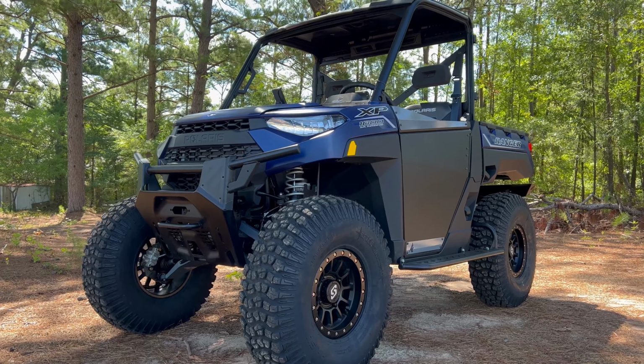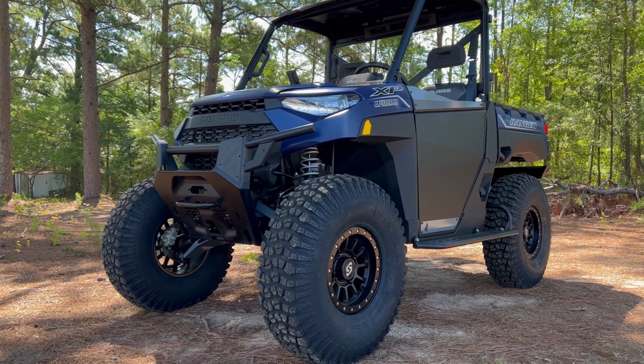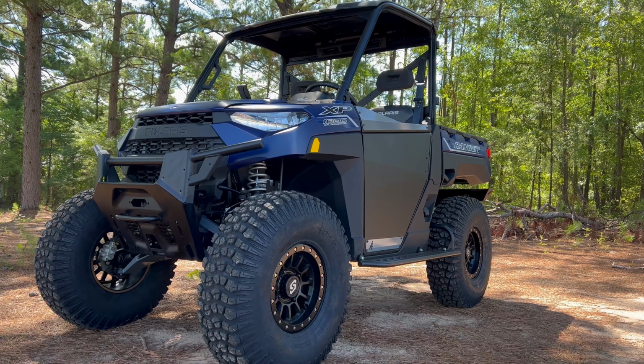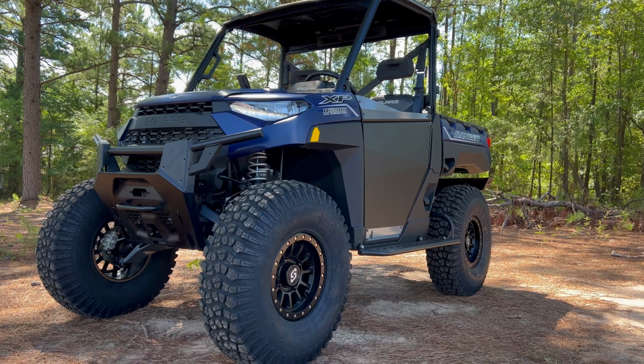That was a very common problem when we started down this road of design: what do we do with this lower ball joint? Even the heavy-duty ball joints for this lower ball joint design, it's still a weak point, and it limits a lot on what you can add there as strength on that lower control arm.